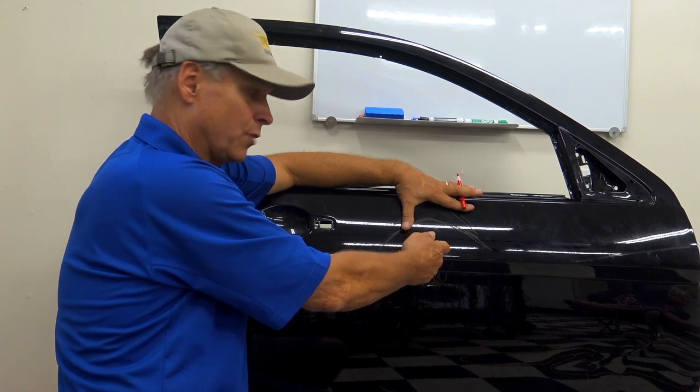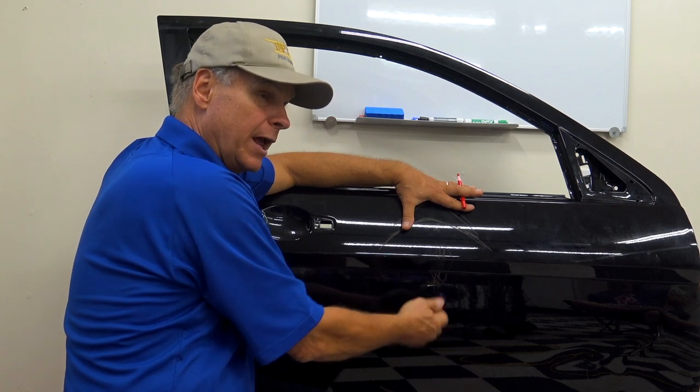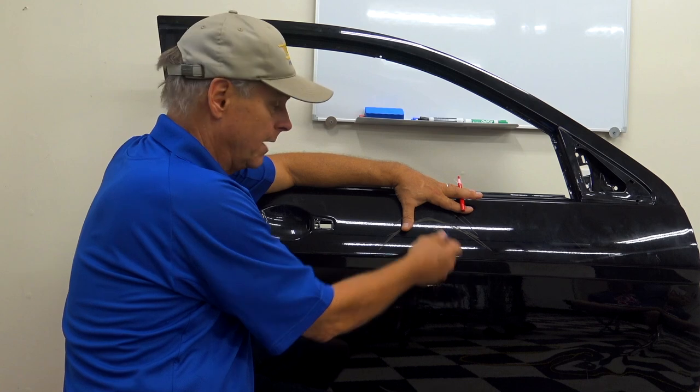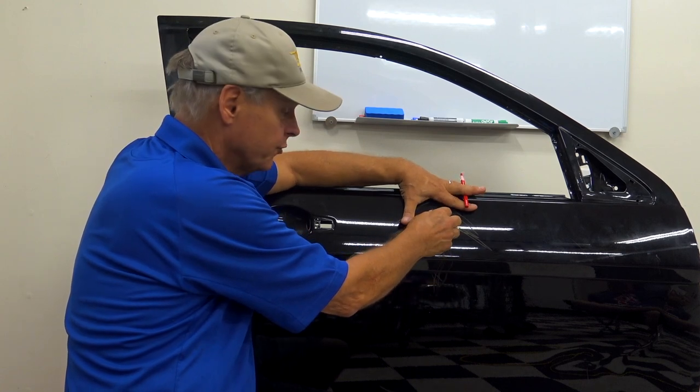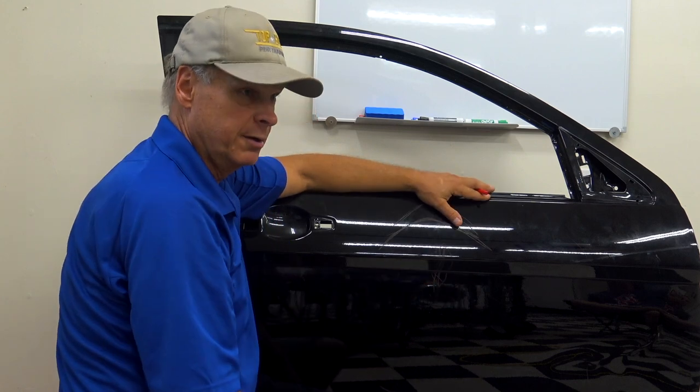So if you have like three straps, one on the body line, one on top, and one on bottom of a tab, pulling simultaneously, maybe 100, 150 pounds max on your body line. This is where the bulk of your effort's going. So we're washing that crown on the body line just like we did with our regular dent.